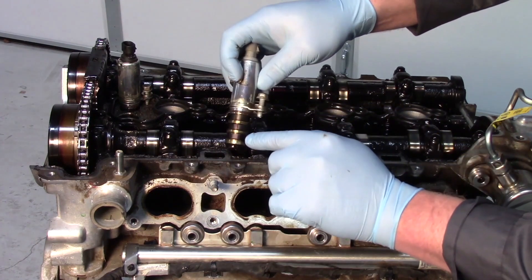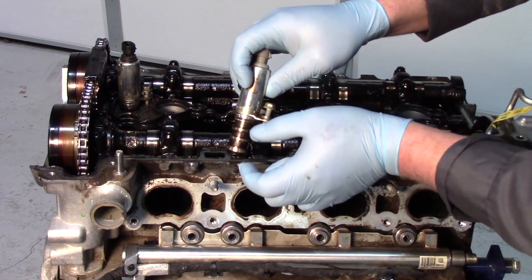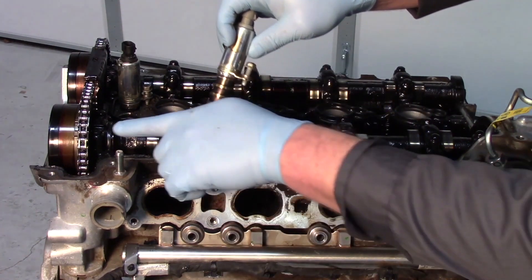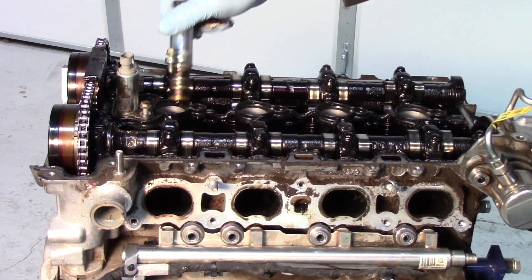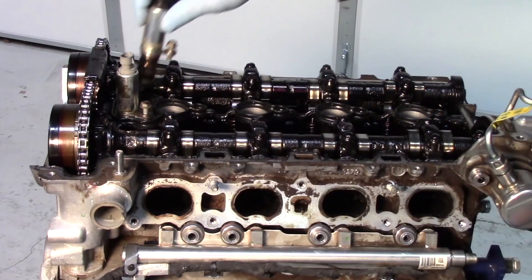As you may recall, the engine oil is going to enter in. The solenoid will be cycled and allow the oil to go towards the advance or retard cavity of the passageway on the actuator. We can see the exhaust solenoid as well — there's a fair amount of sludge buildup on this one too.